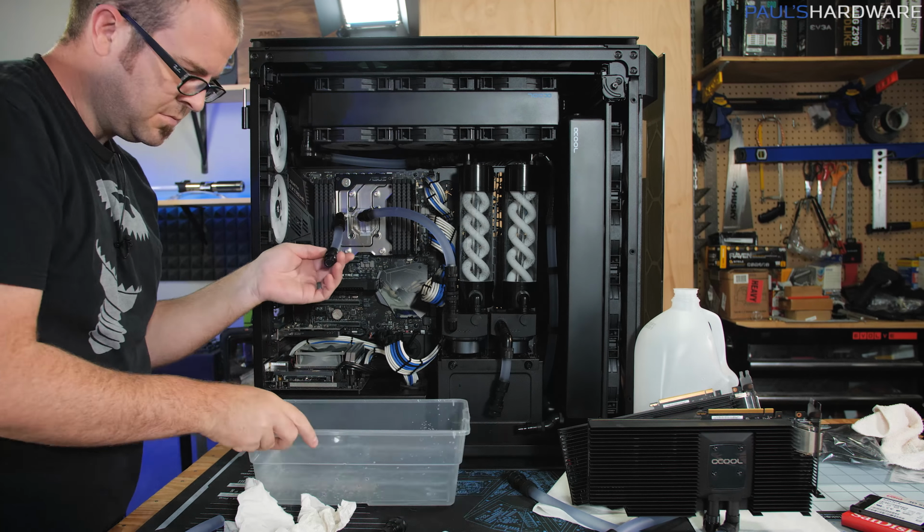For now, we'll use the surface mounted power button. This is promising initially, both pumps working. Oh, look at that. Excellent progress. Beautiful. This is your pretty common just swapped to CPU message, new CPU installed, and it's also giving me a fan speed error because nothing's plugged into the fan header.